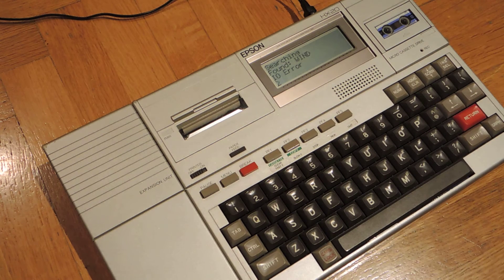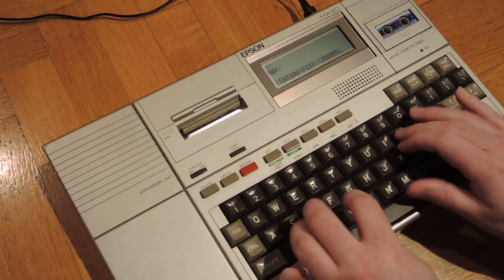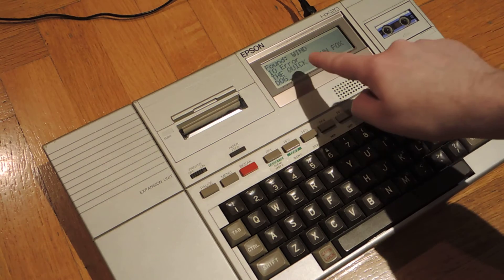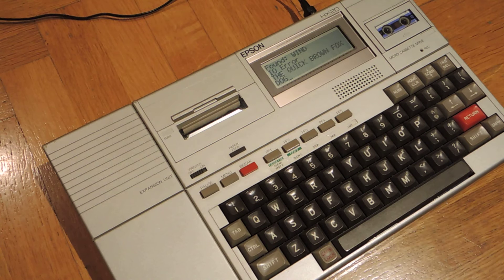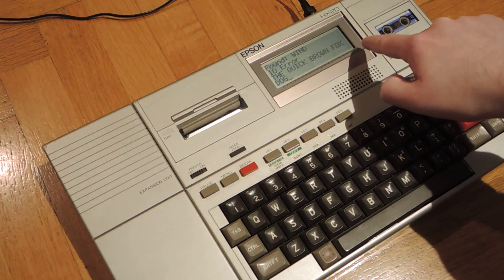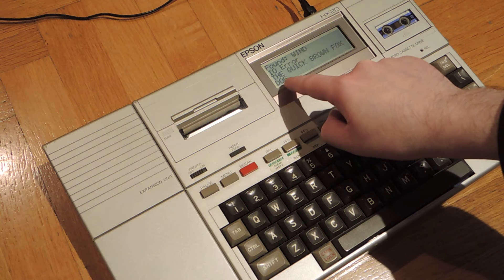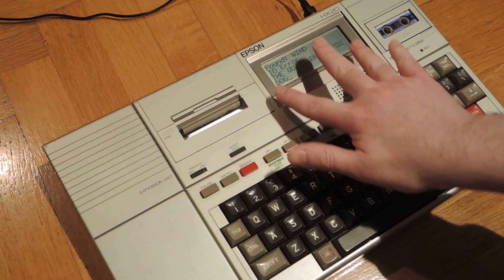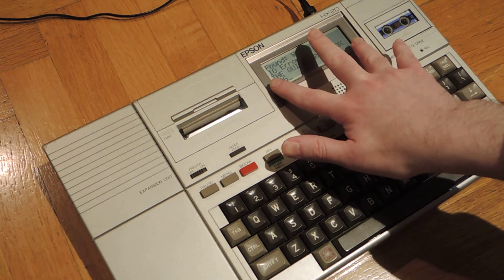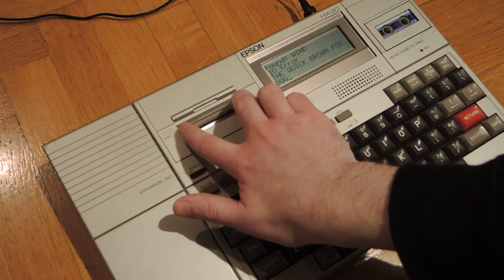Okay, now I'm going to type something and also show the printer. You can see this screen isn't very fast to refresh at all, and the computer is actually very slow — below 1 MHz; the processor is in the hundreds of kilohertz range. The screen contains 20 characters but there is some virtual window, at least that's what the manual calls it, containing 40 characters — which I think is how many the printer prints.